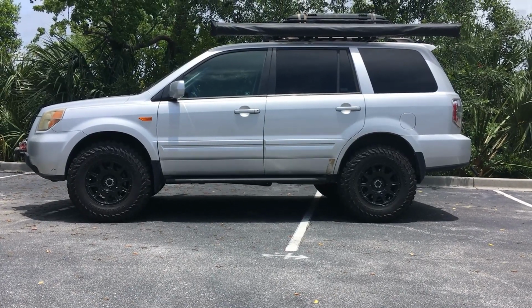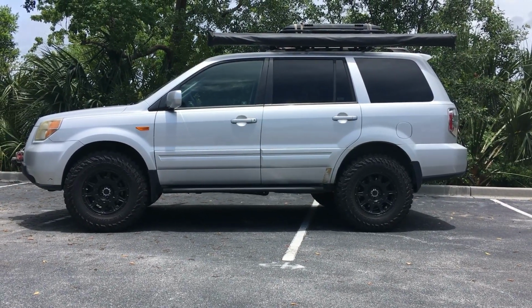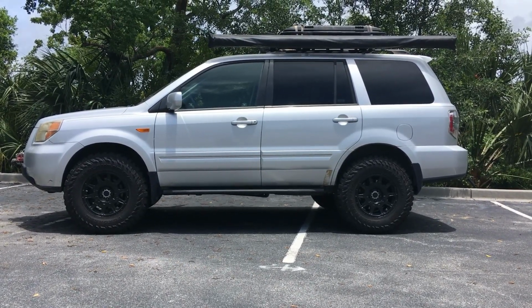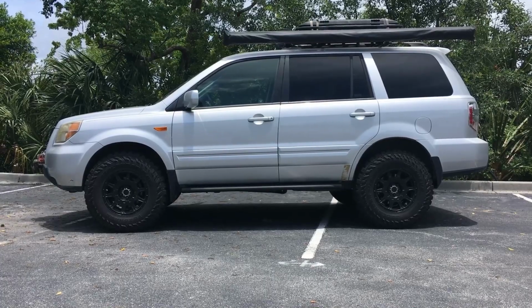But I have the air springs in the back that allow me to adjust the height in the rear. Right now it's got about 20 PSI. It's sitting kind of middle height. But my front end has been a little low. Like when we've gone to Uwharrie, it's just sitting a little low. My skid plate height in the front is less than 12 inches. I think it's right at 11 inches.